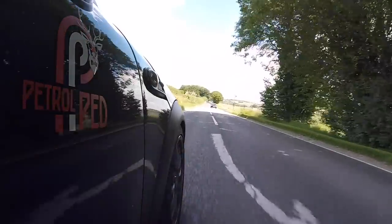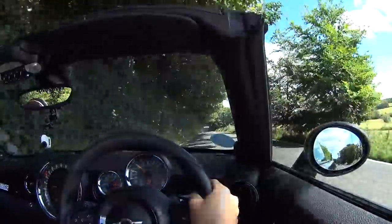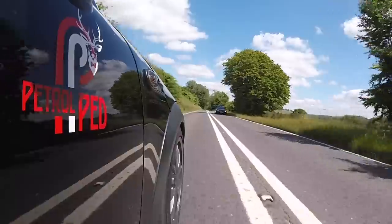And the other thing also is the angle of attack at the front has been reduced a lot. So I even noticed a minor scrape in a fairly severe multi-storey car park just at the weekend. So if you're going to lower a car, if you're going to fit coilovers, that's something you might need to bear in mind. The ride comfort is going to be compromised, and you do need to approach things like speed humps and, certainly, when you go onto a pavement and there's a fairly severe up slope, you're going to have problems potentially.